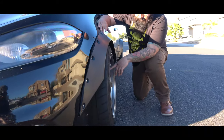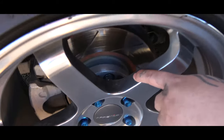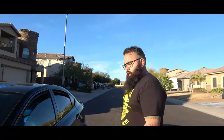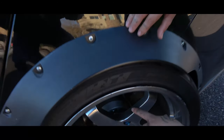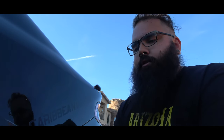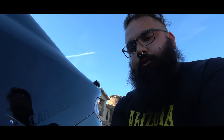If you come in close, you can actually see right inside here that I do have a 25mm spacer. I will go ahead and provide a link to the gentleman I had these made from — I believe he's out of Nevada. There's 25mm in the front and 35mm in the rear. One really beneficial thing about spacers — I know a lot of people run into concerns like are they safe — don't cheap out, don't go on eBay, don't get a $60 set. These four sent me back almost $300.